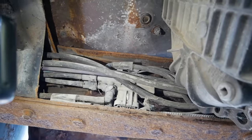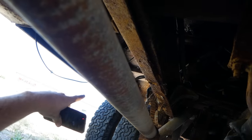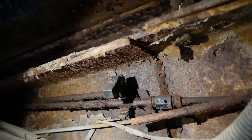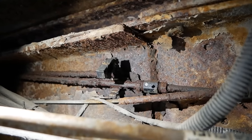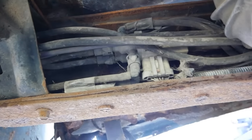Okay, so I'm under the truck trying to figure out why our mechanical fuel pump was never working. I know these tank switch units love to fail, and I have played with the switch. One of our tanks shows half a tank and the other one shows infinity, and that's because there's only one tank now. This guy's gone. As you can see, there's the hoses right there, and those run straight across to this line and in. But there's this line back here. As you can see, it's only half there. This bugger runs to this bottom port here. You can see it moving a bit.